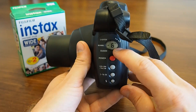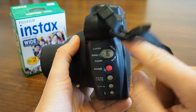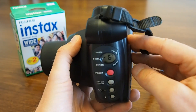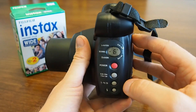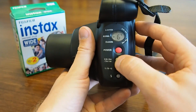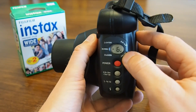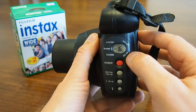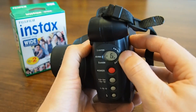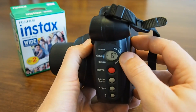The default position for the camera's focus is 0.9 to 3 meters. If you want to take pictures of something between 3 meters and infinity, you press the corresponding grey button once. The black arrow on the screen now shows the changed focus area. If you turn off the camera and then turn it on again, the focus area will reset to the default area of 0.9 to 3 meters.